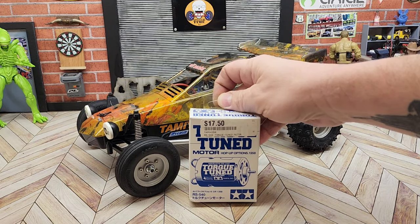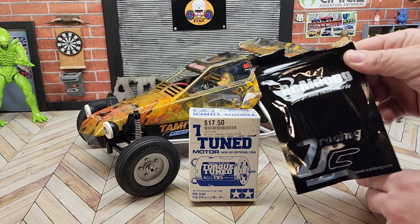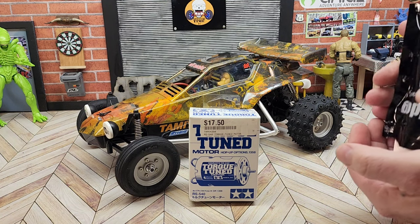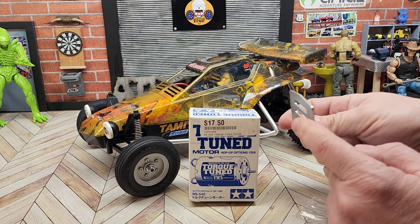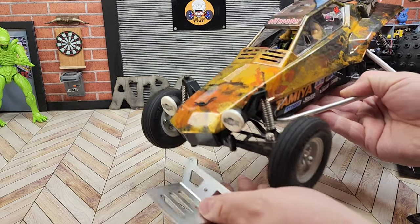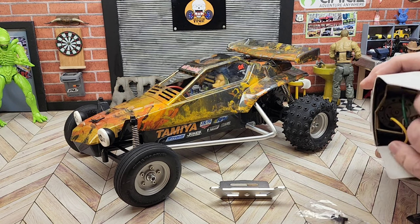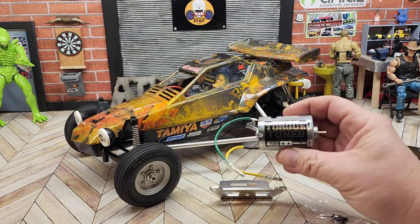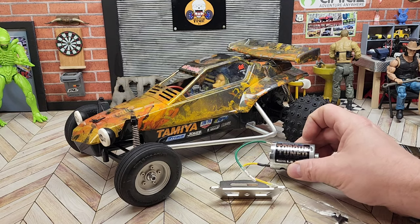In the spirit of this - since this was a gift from a good friend of mine and I kind of want to pay homage to that - I just keep wanting to work on this thing. So we're going to remove the silver can and we have a torque tuned motor. You can see I have the front bumper off because I have a new front bumper for this too, and this is from RC Adon. It is a really good looking profile aluminum bumper and it should just go with the overall look of the car. That is nice and it is solid. That's good because I've bought some of these from other companies and they have literally just folded over upon impact. That'll sit right in there. And let's get out our torque tuned motor - that's going to replace our little 540 Mabuchi, however you want to call it. A nice torque tuned motor, so it ought to give us a little bit more pep to the step and look a little bit nicer because it has that sticker on it.